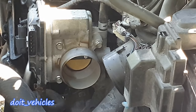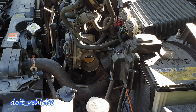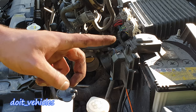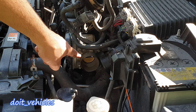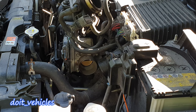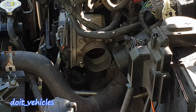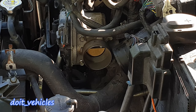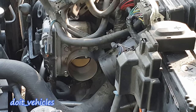From this point, if you have a closer look at the throttle body plate, you can go ahead and reconnect the throttle body. Now when you turn the key to the second position in the ignition and press on the acceleration pedal, you should see the throttle body move proportional with the acceleration pedal. Let's see if that happens. As you can see, the throttle flap moves accordingly, which is great.